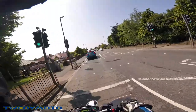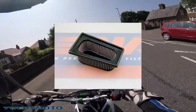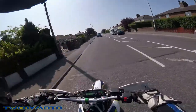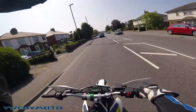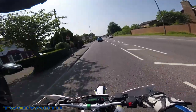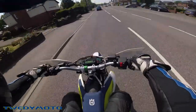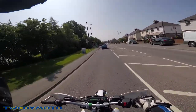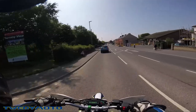I've got some tuning to be done on my bike. I have bought a DNA filter and the plate that goes on top of it that holds it onto the box, instead of having the normal airbox lid or the Evo mesh lid. Basically it's just an open hole just under this plate where the keys are — that's where the air goes into. So yeah, that's the intake that I've got. DNA call it the stage two intake mod.